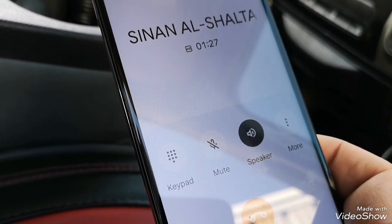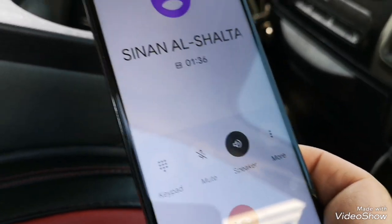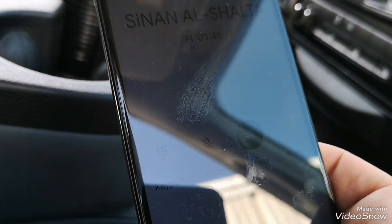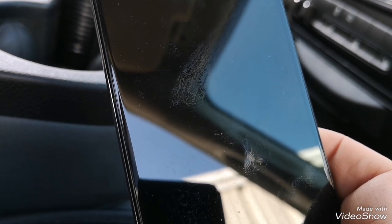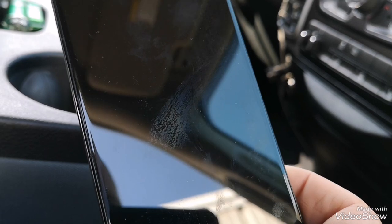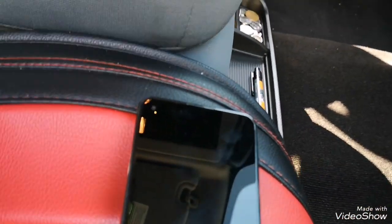So, there's a deal for you. Are you going to come and fix it up completely, change the piece, and tell me how much it's going to cost? You'd have to send me the model number so I can see if I can find a timer first. I was searching on the internet as well. There's the plug you plug into the motor, a $10 part. Maybe it'd be that as well. Oh, you mean the starter? Starter relay. It's a little relay that clicks on and off. Yeah, that could be it too.